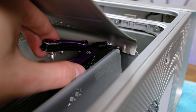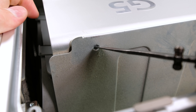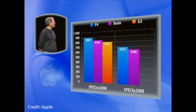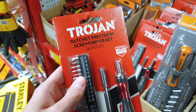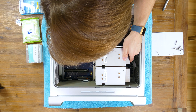I tried squeezing out the rivet with my multi-tool, but it was just too hard to get a good grip. Since this rivet is never going to be used or put back in the machine again, I chose the brute force option. With some patience, it actually worked. Sliding the plate across, we have our first look at the beefy CPU heatsinks — one for each PowerPC G5 processor. In an age before multi-core CPUs, this computer actually had two single-core processors. The CPU exhaust fans were next to come out, along with a small plastic bracket. Removing the CPUs was a bit tricky — you needed a really long screwdriver, but one trip to Bunnings later I had the tool I needed. After a few attempts I had all the CPU screws removed and could finally uninstall them. With a bit of wiggling, they came right off.